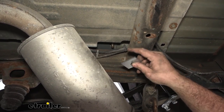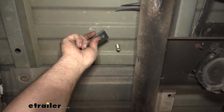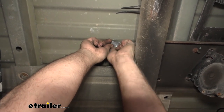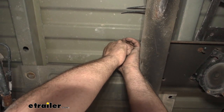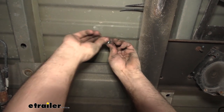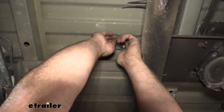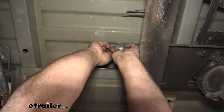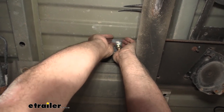Now getting the hardware up here is gonna be a little bit tricky. So I'll show you on the center one exactly how we're gonna do it for the others. Now the other ones are gonna get a little bit tricky as far as space goes, but it's going to be this offset square plate, a split washer, and then we have a nut. But since this is on the bottom of the corrugation, to space it, we need to put our U-shaped spacers. So we have this in place. So we can just slide this in, and then I'm gonna just hand tighten this up to where it's nice and snug. We don't need to get any crazier than that because we are gonna want this not completely tight, just snug, because we're gonna put our rail in to find out where we're gonna mount our front rails in place.